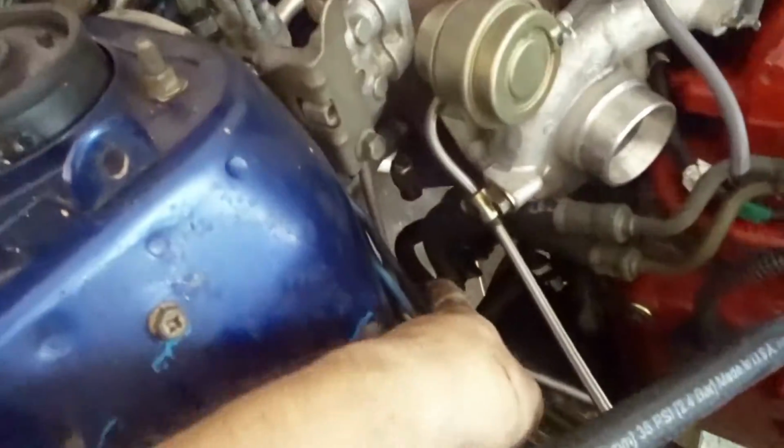It's dark, I don't know if y'all can see that, but I'm gonna extend the pipe out there, from there to there, and then it's gonna be sticking out like that. And then I'll get a 90 degree, or just figure out how to make that go straight up. Whenever it comes straight up, it'll come out and around the CV axle and up towards the turbo. That way I have room for the downpipe to go down.